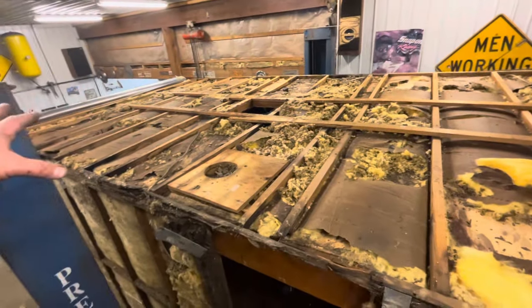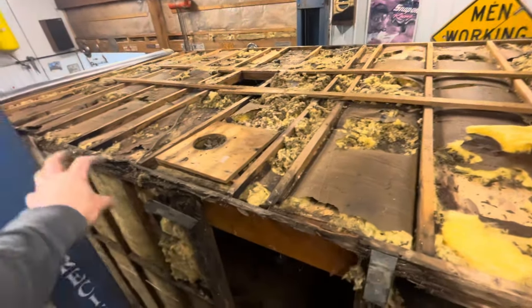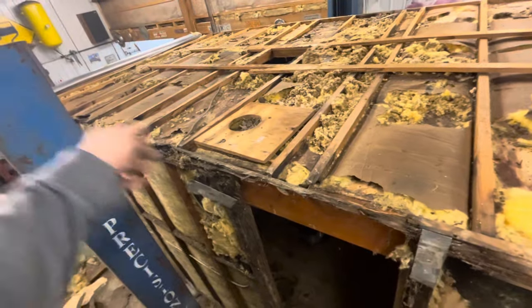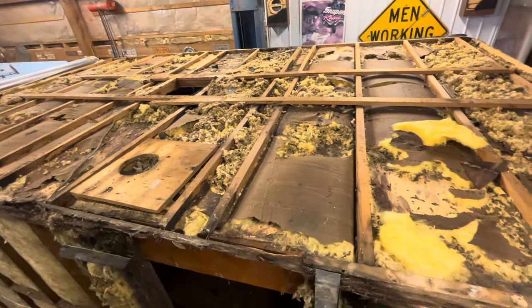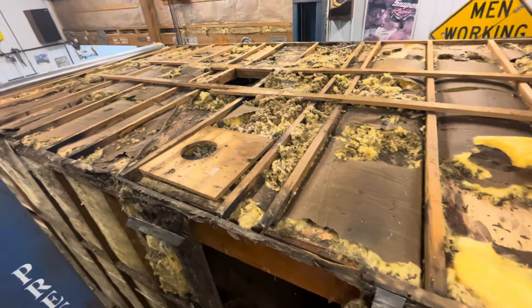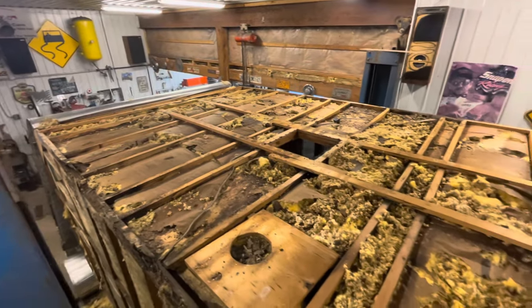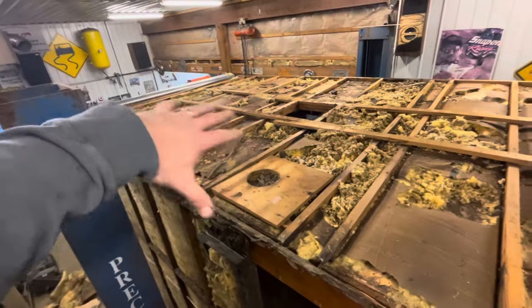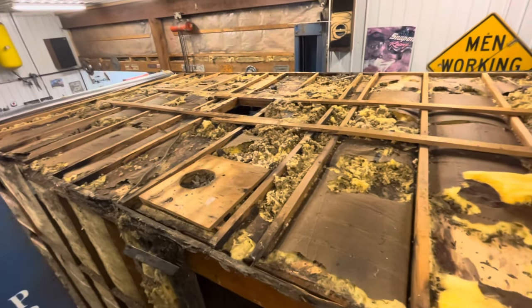And I can re-insulate. And when I'm all done, maybe I'm oversimplifying, but I think it's going to be literally roll that roof tin back out, tack the edges down. I got to get new corners because those came off so hard, they're completely destroyed. But you can buy that stuff. So I'll retape it, put the corners down. I don't like to tar the roof. It's not really the right way to seal up a roof, but this one being in the shape that it's in, I'm going to have to tar it because they had screws and nails through the tin to hold that other roof thing on, and it's kind of a wreck. So it's going to have to be tarred up pretty good when all said and done.